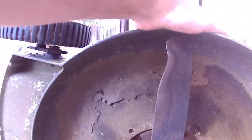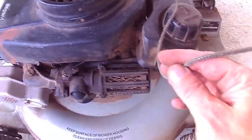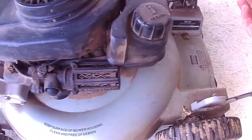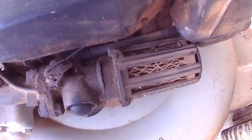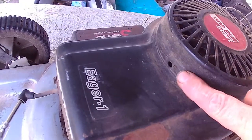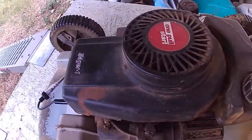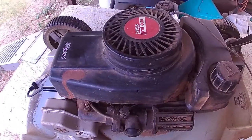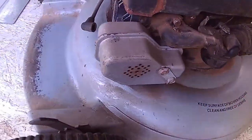The underside looks pretty clean, everything looks pretty solid, blade's not bent. One of the things we wanted to assess is the condition of the pull cord — we can see it's broken. It doesn't affect it because it's a long pull, but we are going to replace it. To do that we're going to have to remove the gas tank. There's a bolt right there, one right there, and there should be a third one but that's missing. Whenever we're working on stuff here we want to be safe — I've got the spark plug out and disconnected.